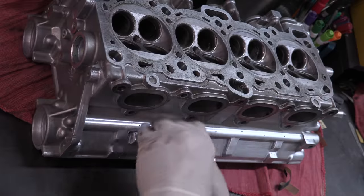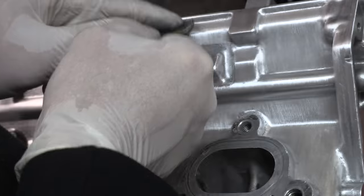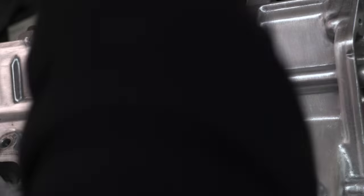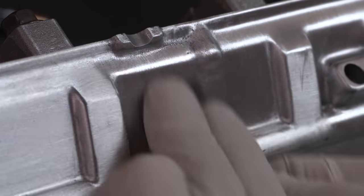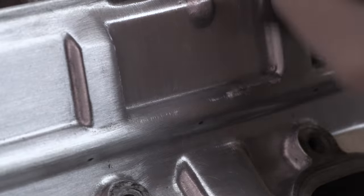The bad news is you're not going to see much difference in the process here on step 3 as you did in step 2. You're just going to see a difference in the attack and what happens on the surface of the aluminum. If you did steps 1 and 2 right, the Gumby effect should be gone by the time you begin step 3. You've got flat, straight surfaces to work with. A little bit more planing will occur because of the grain crossing techniques, but that's just enough to keep it straight as you proceed through the later steps.